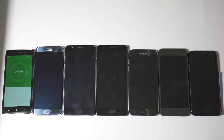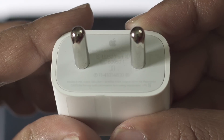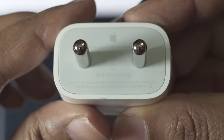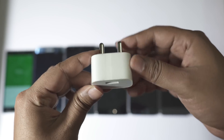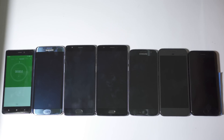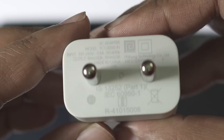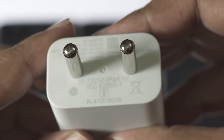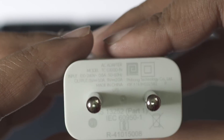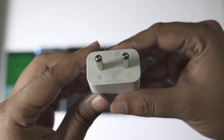The last device will be used as a stopwatch. Let me now quickly go through the charging adapters you get with all these phones. First, the iPhone 7 comes with just a 5V 1A adapter with a 5W rating — if you are coming from iPhone 6s you will be totally annoyed. The Google Pixel comes with a fast charger rated at 5V 3A and 9V 2A, which is 18W maximum — really impressive.